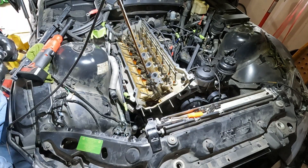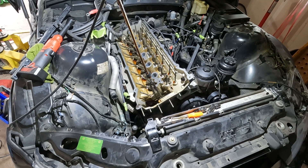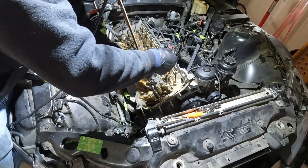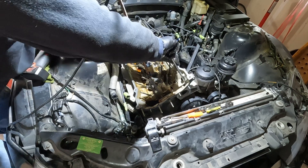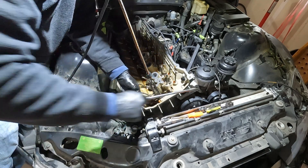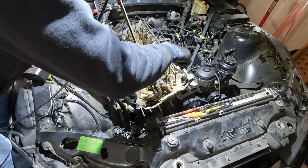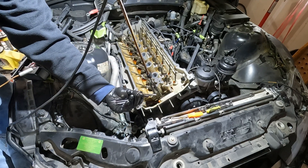Now I have some smaller head bolts — one here and one here on the two corners. I'm going to need a bit of a longer extension in the engine, and I got a head bolt down here which is also an E8. Get a magnet and pull these out with a magnet. Take note again: the longer one goes up top, the shorter one goes down the bottom.